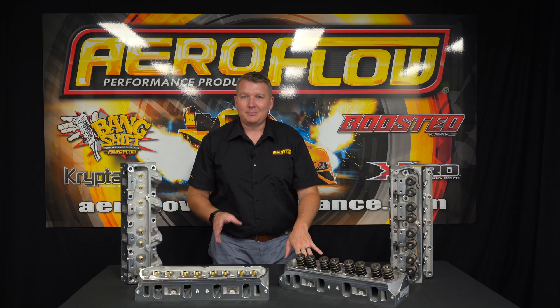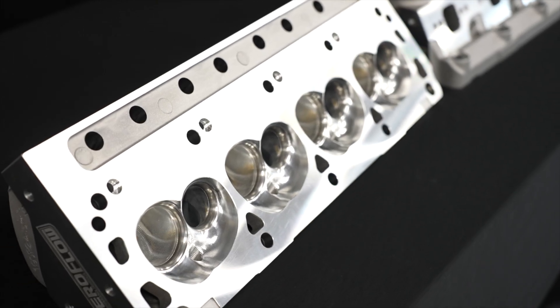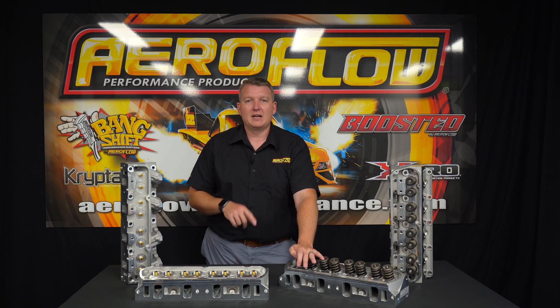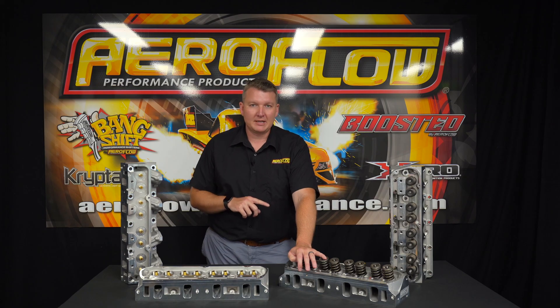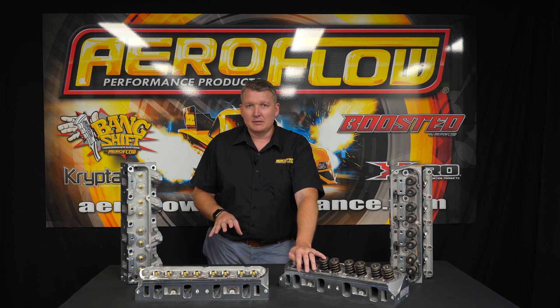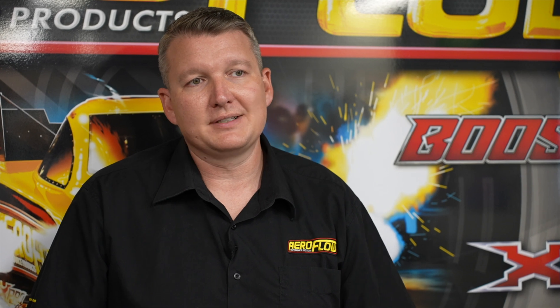I need to reiterate — please speak to your engine builder or your cam guy and do some research if you're putting the engine together yourself, so that you choose the right size and the right application. If you're looking at the complete heads, because it's very convenient to just bolt one on, make sure you check the specs for the valve springs and valves to ensure they suit your cam combination. If they won't suit the amount of lift you've got, or if it's too large of an inlet runner, the car's going to lose bottom-end torque. All the flow specs and valve and spring specs are available in our catalogue or online on our website.